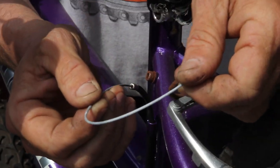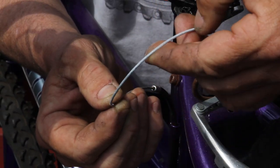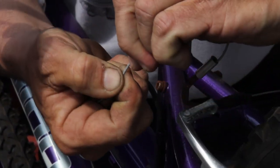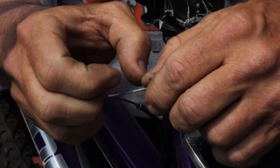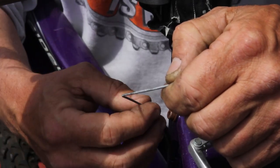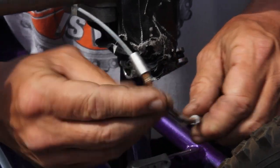You can see the white powdery film, and look at how it's coming right off of my fingers — she's definitely getting corroded. What happens is inside of the casing it gets corroded and it just expands ever so slightly so the cable doesn't run very nicely. The brake is going to return a lot better after we get some lube and a nice brand new cable.